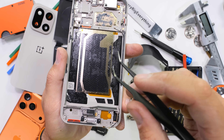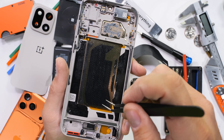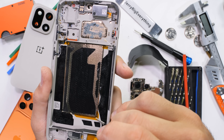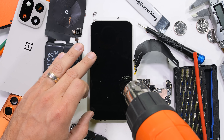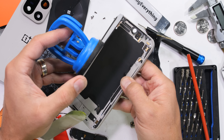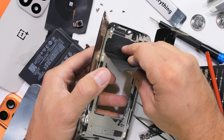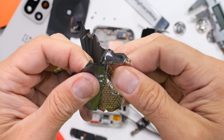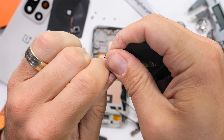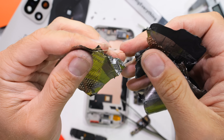The vapor chamber is stuck under the screen, and if we remove the screen the phone dies. After a team vote, let's get rid of the screen. With the screen lifted up, the vapor chamber and its graphite coating is now visible, and it is indeed extremely large. OnePlus apparently wants the vapor chamber thin enough to be tearable so it can transfer heat quicker to the vapor inside, since the phase change is what's doing the heavy lifting when it comes to cooling. And would you look at that — the vapor chamber of the OnePlus 15 is in fact tearable.